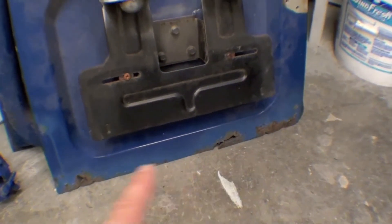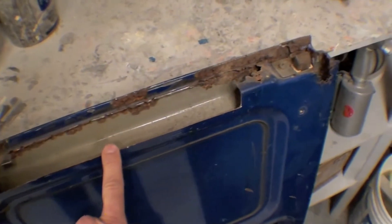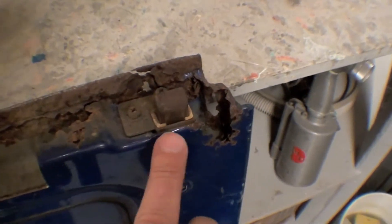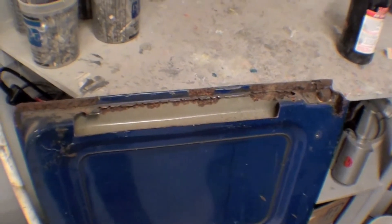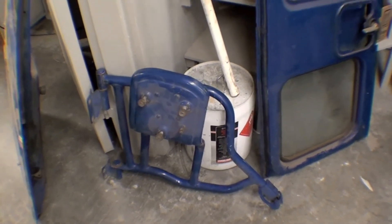I think this one will be sandblasted and be fine, but the passenger door is going to require a complete patch there. Up top on the driver's side, it's completely rotted out — already been cut out by the customer — and this striker here is interesting. We'll go back in, put the new bottoms on, reaffirm the striker, and the rest of the door is pretty straight. It'll be a nice restoration. Lastly, the spare tire carrier is in fine shape — might do some bushings — but overall after sandblasting it'll be in great shape.